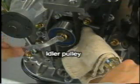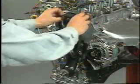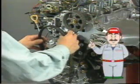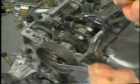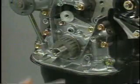Loosen the idler pulley bolt. Loosen the timing belt and temporarily tighten the bolt. Then remove the timing belt and idler pulley. Be careful not to bend or twist the timing belt excessively. Do not allow the belt to come into contact with water, oil, or steam. Remove the crankshaft timing pulley and camshaft timing pulley. This completes removal of the timing belt.